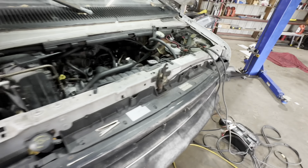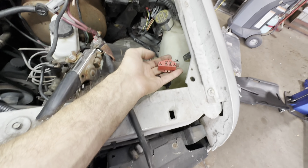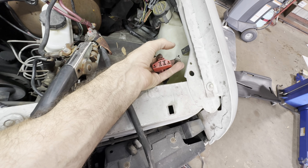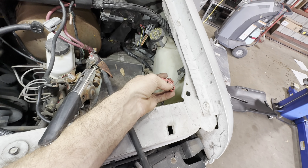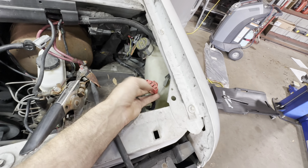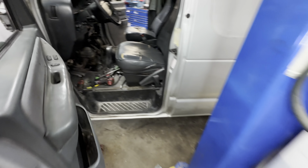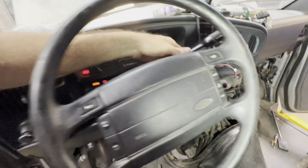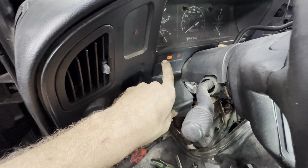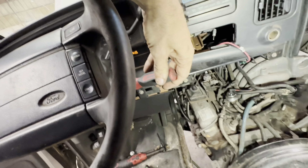This being a pre-OBD2 vehicle, I don't have scan tool capability. So what we need to do is retrieve codes manually through this connector here. What we do is take a jumper pin and connect this unit right here — I believe it was that one or that one. I tried to retrieve trouble codes from the ECM. When I set up the jumper, let me just do that right now — let's fetch a paper clip. Let's jump it right now, I'll show you what I'm talking about.